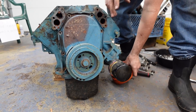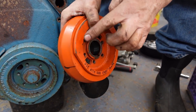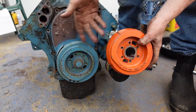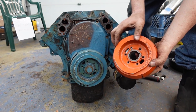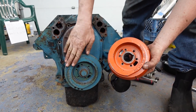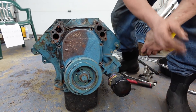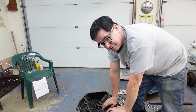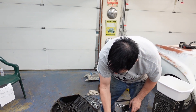There are actually a couple of varieties of this damper — one has the same 'cast crank only' message but is tapered rather than squared off. Whenever you see that eccentric, uneven weight, that's a sign of a cast crankshaft inside. Since we're going to be using a 440 Source billet stroker crank to take this out to 513 cubes, we don't really care — but that's the story.